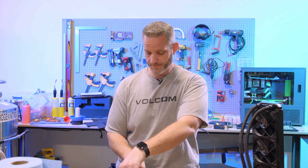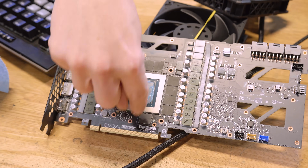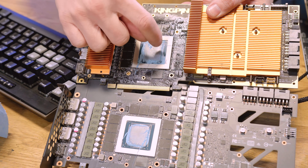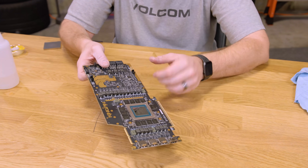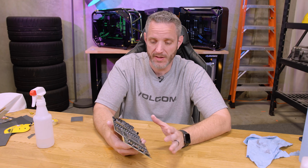One of the things I'm going to do is throw the card in our ultrasonic cleaner and get it nice and clean, because there's so much crud on it from all the tape and insulation material. Look how far to the edges that went without even using the clamp! Here's a perfect comparison — here's the 3090 we just did versus what my Kingpin 3090 has been looking like with the clamp. Do you see the actual circular pattern in the center with how thick the thermal grease is around the edges? Compare it to that one. We might finally have gotten somewhere. Here's my nice cleaned-off Kingpin 3090 — the same exact card we've been using for our tests, over 200 runs, the same card we hit 2640 on.